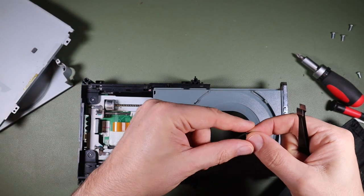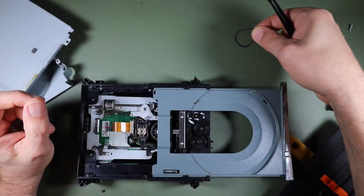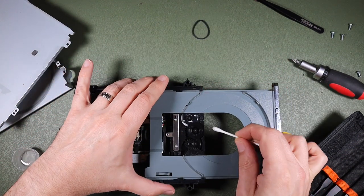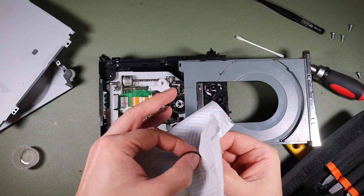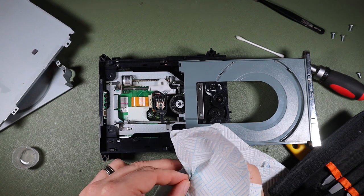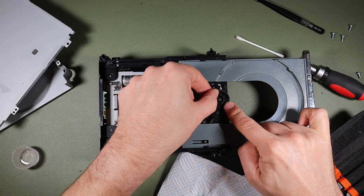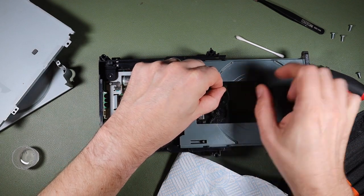I probably would have had similar belts left over from other repairs if only I had thought to keep them — but of course I didn't. So I decided to clean the wheel of the drive's eject mechanism using IPA on a cotton bud, moving the drive tray backwards and forwards to rotate the wheel and clean all its surface. I also decided to clean the rubber belt using window cleaner — my theory being it was slightly less aggressive than IPA on rubber. And then there was the tricky decision of whether or not to clean the laser.